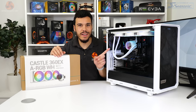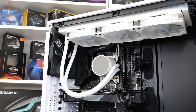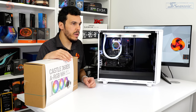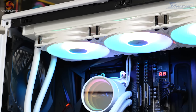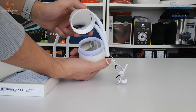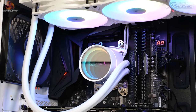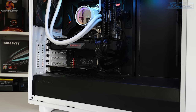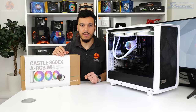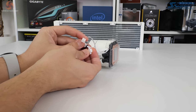Physically, the pump block unit is absolutely massive, measuring in at 86x75x71mm — this is clearly not an ITX-friendly pump block design. The overall shape is cylindrical and it maintains that clean white appearance throughout the cooler. Deepcool deploys the eye-catching infinity mirror display that features the brand name, and the top cover can be removed so that the nameplate can be rotated in 90-degree intervals to allow for correct alignment of the orientation irrespective of installation preference. There's also eye-catching ARGB LED lighting that shines through the infinity mirror display as well as in a ring around the pump block unit. The dual chamber pump itself is powered by a 3-pin 12-volt DC connection and that 3-phase motor spins the pump at 2550 RPM.